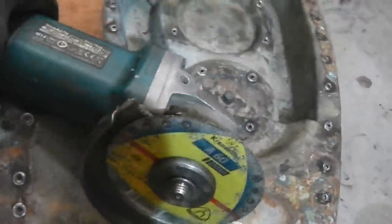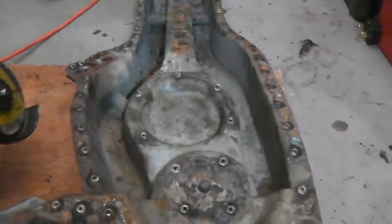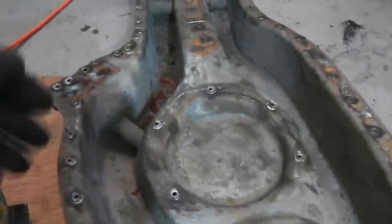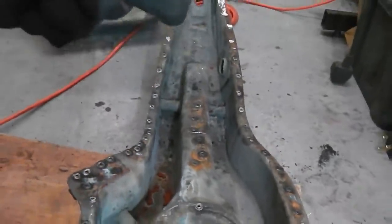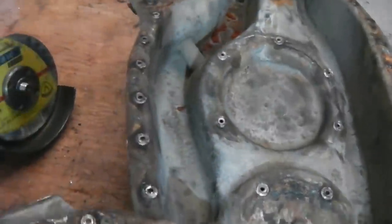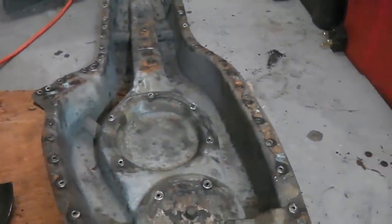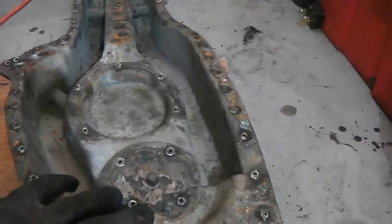So really my main point is, do not underestimate your angle grinder. You use that in this application when we're removing loads of spot welds like this, and whilst we might have been able to peel it up this way like a tin opener up to here, it starts getting a little bit tricky when you're coming around some angles and stuff. So then you can just slice it off and carry on. Then your chisel can get into other places. So look at it systematically. Don't just charge in there, but reverse engineer it and break it down, and that'll give you a much better progress rate and a neater job.